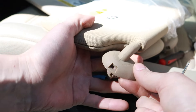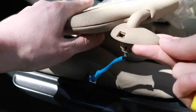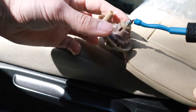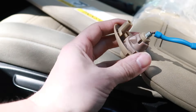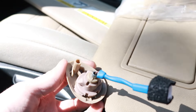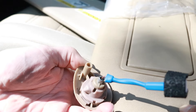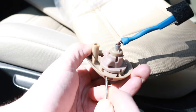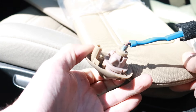I'm going to take a flathead screwdriver and just push this in and rotate. The aftermarket one is so much easier to loosen up. This tab basically allows the twist lock to lock into the metal upper roof housing. You can see how it locks if I rotate this — that's the locked position and now it won't back off. So again, take the flathead screwdriver, push this tab in, rotate, and that's the unlocked position.